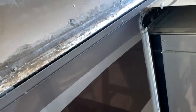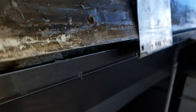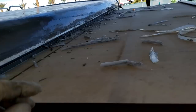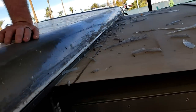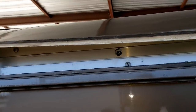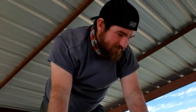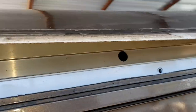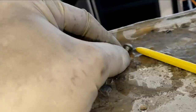Somehow this special tool worked. We just made a little J-hook — we got that bend to get underneath and we can pull it up without putting a lot of undue strain on the edge. Now if you look underneath, somebody used a lot of foam insert. I know that screw head's broken at the end but it has to be loose. So now we just have to take these screws off and this molding will be out of the way, and then we can finally get to the sidewall pulled back. Chad gets the rest of those screws out for this gutter. Those were broken, that one was broken, that one wasn't, and the end one was missing.